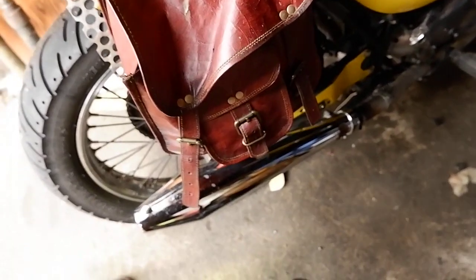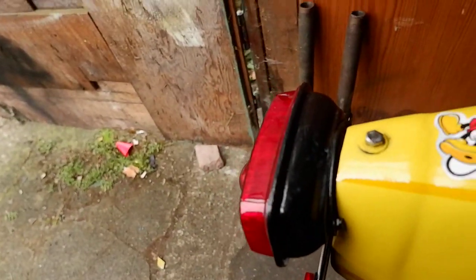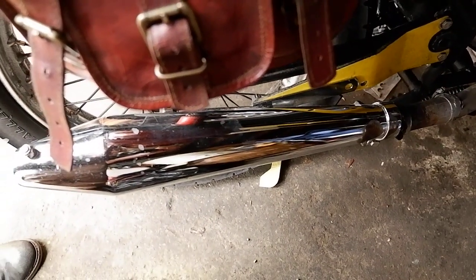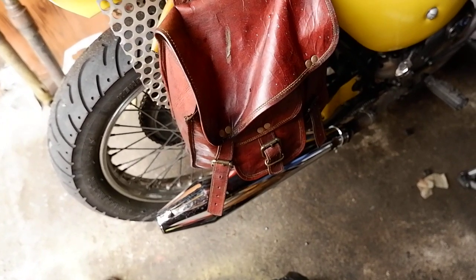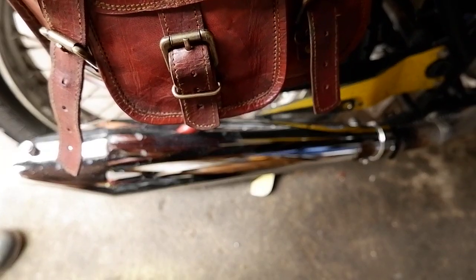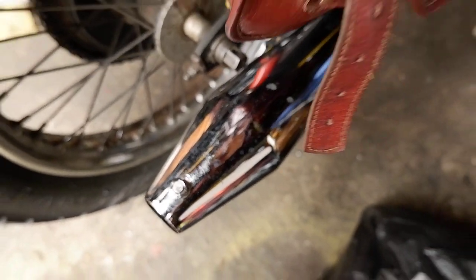In the muffler, I added 17 inches in this section of tubing. I cut a piece of 1-3/8 tubing, put a bunch of baffle cuts in it, bent them, and put that in the whole front section. There's some baffling in the back still and it's still crazy loud. I'd definitely have to make a more sophisticated baffle for the larger section in the middle — that 17-inch section to the back divider, right there on that lip area. Have a good day guys, see you soon.